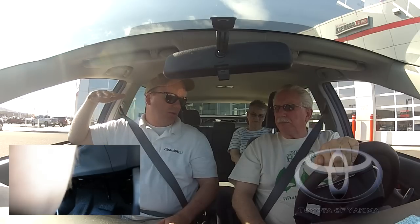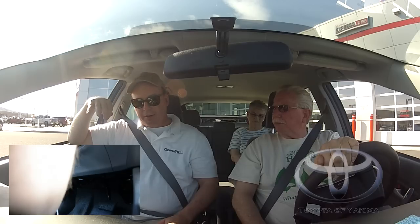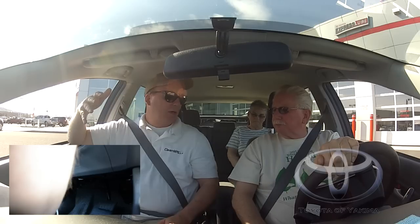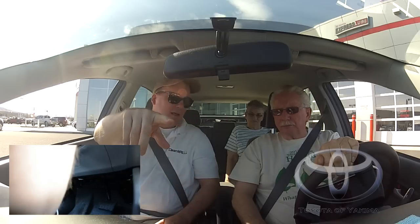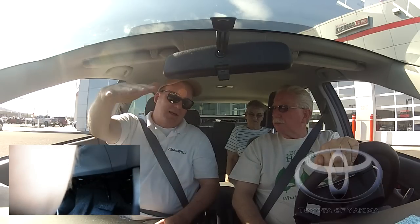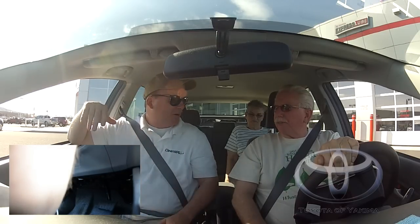Going down, watch the video, do all the stuff that we've done. There's more to it about warp neutral and the limits at 62. But you can use your foot to maintain yourself in warp stealth, in a regen area. There's a lot of things you can do going down the mountain to not only save, to not burn any fuel, but to absorb some of that and fill the pack. And you'll see it climb all the way to the top in some cases. And then when you get into town and you've got this thing all jammed, you can drive 2 miles around town on EV because you got it all out of the mountain. I've done that many times.